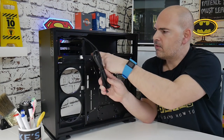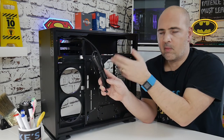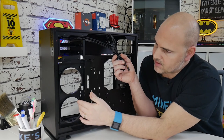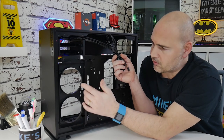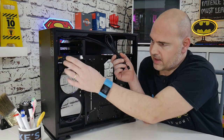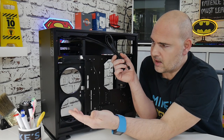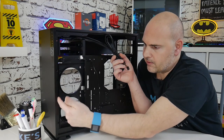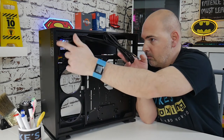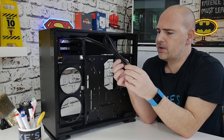There's a massive basement area with loads of cutouts at the top to run your cables through, plus a big area for the fan to pull air from inside and out. This plastic tray is where you mount the fans on the other side — good access there. The only downside is you can't really run cables down past it without blocking airflow or risking them getting jammed in the fans, but you can run cables down the channel and along through the top.